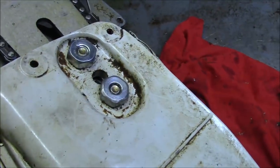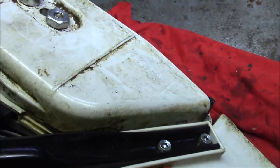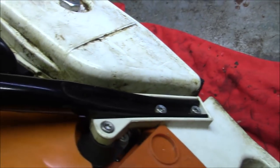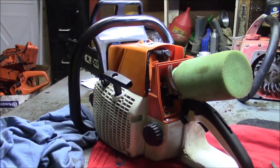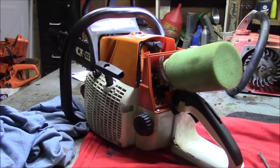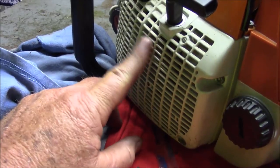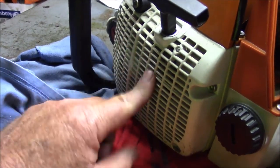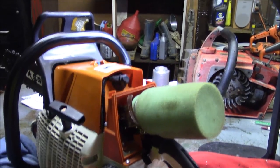Husky decomp, OEM bar studs and nuts. It actually has a different drum too. It doesn't have the drum from Farmertec. And it's got a muffler mod. I had to swap back to a standard top end, the old style, because the new style fragged. And I think I have different dogs or sprags, or whatever you want to call those things, in this pull start. But other than that, that saw really is just bolt-on stuff. And it's a lot of fun.